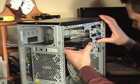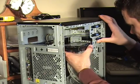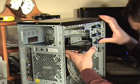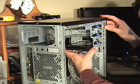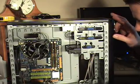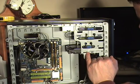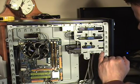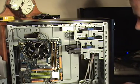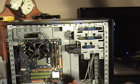We're going to go down one slot — this slot here is for a floppy drive, which I don't think anyone uses anymore. So we're going to go down into the bottom here. Now there are holes that are perforated into the case that line up with the hard drive where you put bolts into. You're going to go ahead and secure the hard drive in four places — two on this side and two on the other side.